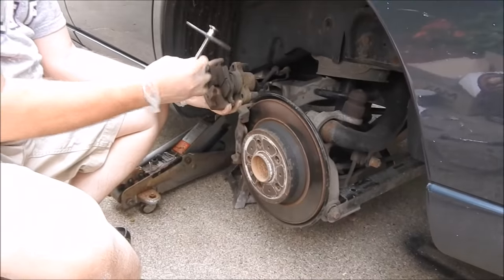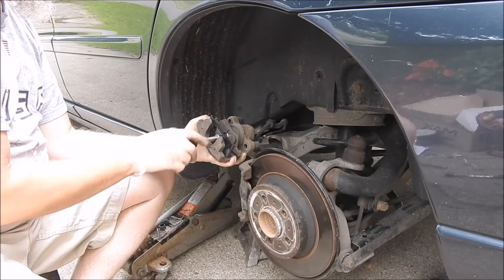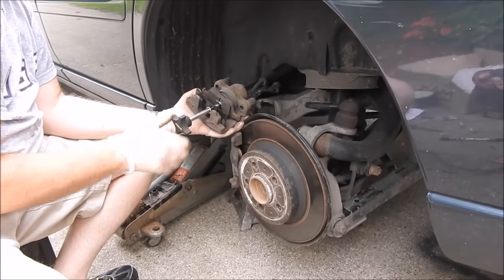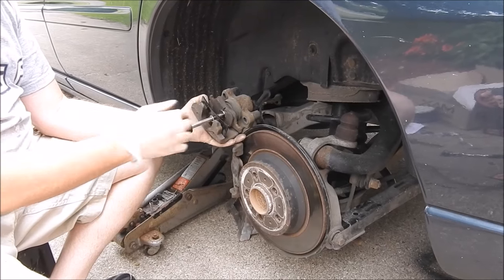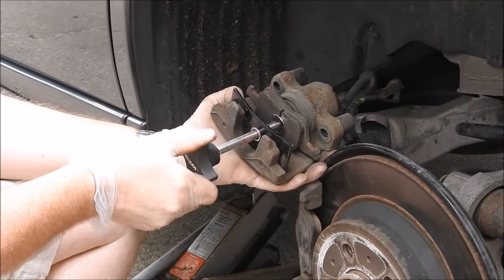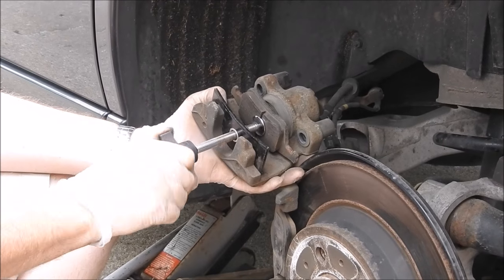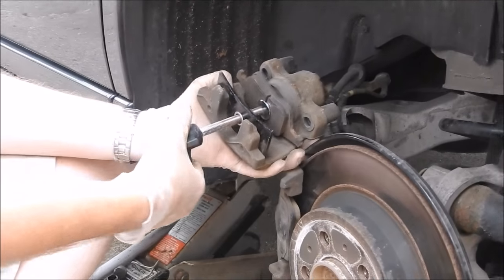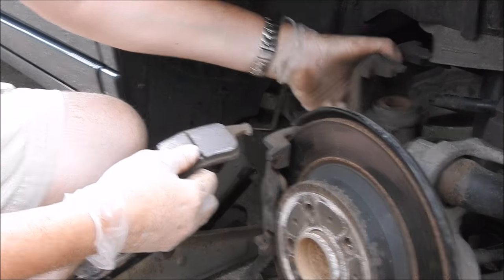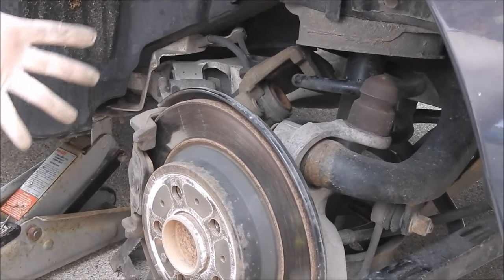Now I happen to have this, which I absolutely love. It's a brake caliper pad tool made just for this. You keep one of the pads on and this plate backs up against there — it's only a few bucks, I think I paid like six or seven dollars for it. I can never find my channel locks or a C-clamp that fits. So this is a universal tool, it works really well. Just push until it stops, take it off, and you're done. I'm going to set the caliper aside — thankfully it'll rest right there on that spring and stay perfectly out of the way.